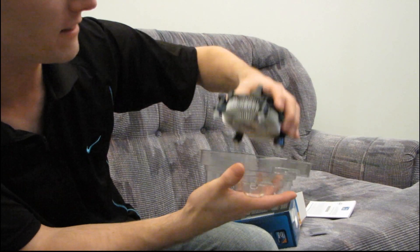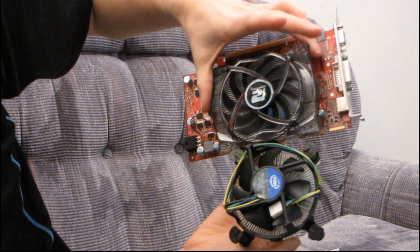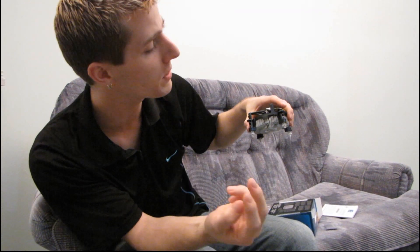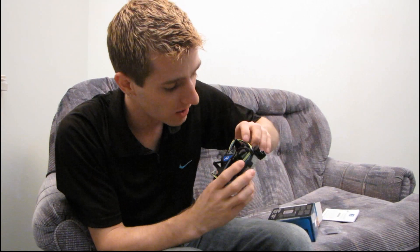I can't believe how small Intel has made these heatsinks. For reference, here's the heatsink on a 5750 — a low-end video card — and it's pretty much the same size, maybe even bigger on the video card. Something I've recommended to customers buying low-end Core i5s and i3s is to just grab an aftermarket heatsink — like an Arctic Cooling Freezer 7 Pro Rev 2. It's a great little heatsink and it'll outperform this, especially if you want to do overclocking. That's not to be down on the Intel engineering team, because a big part of why you can use such a small heatsink is because this processor is so efficient — it uses very little power and outputs very little heat, and it will not die under this little tiny fan heatsink.